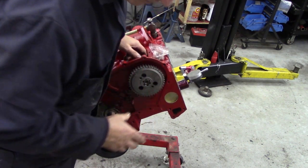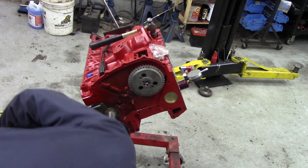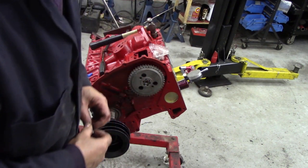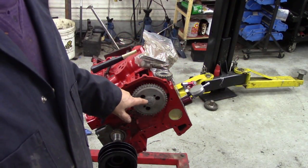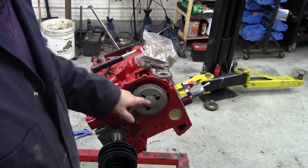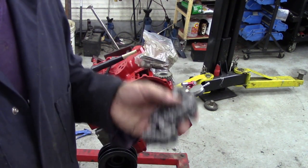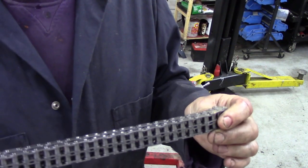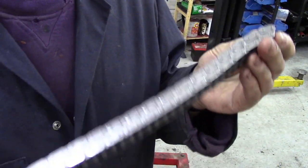Make sure it doesn't catch anywhere. There's a bolt here — I think that's for the cam — and there's supposed to be a washer, but I'm not sure if there's supposed to be a lock washer, so I'm going to check. Well, I found out on the early engines there used to be a lock washer. In the parts diagram there isn't — it just says put a new bolt on with thread lock. So we're going to put some thread lock on that and tighten it up once we've got the timing chain on. Now pay attention — some timing chains are an endless chain, meaning it's been riveted over and there is no split link.